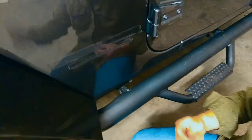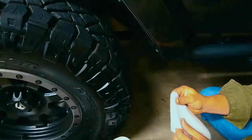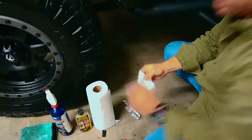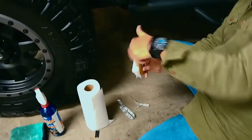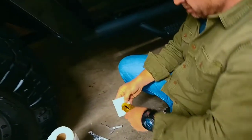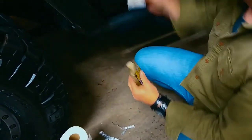So now we've got the decals off — that's pretty simple. I'm going to take a piece of paper towel, and I use paper towel intentionally because it actually has some abrasiveness to it — not enough to scratch paint, but just enough to work your way into the adhesive. I'm going to smear the Goo Gone on heavy at this point, and the trick is to let this stuff soak in for a moment.